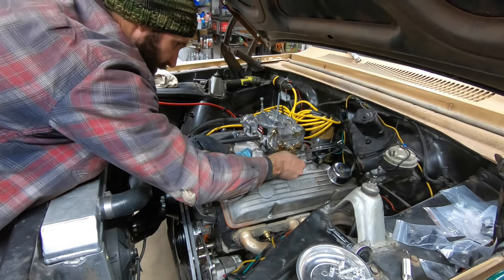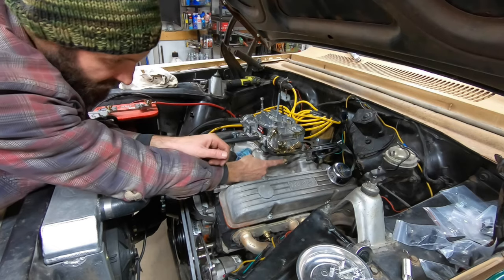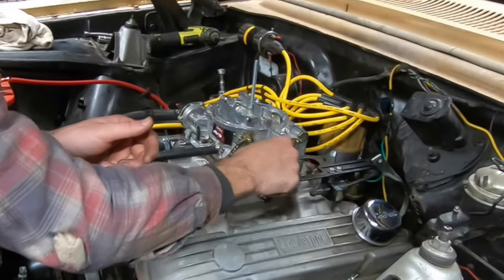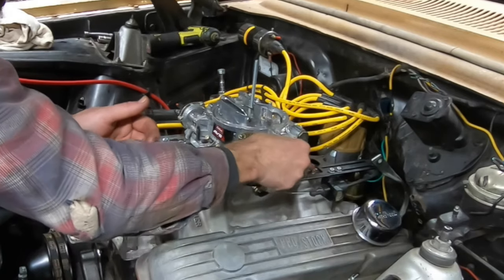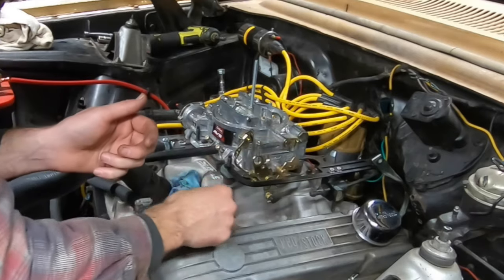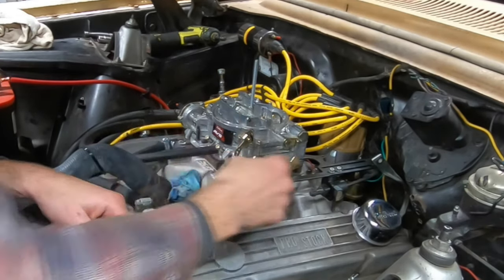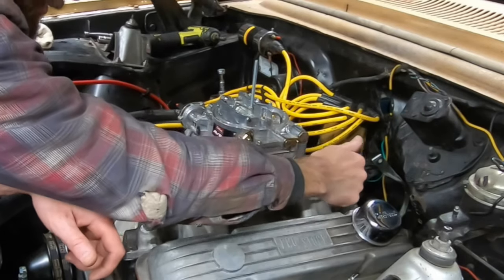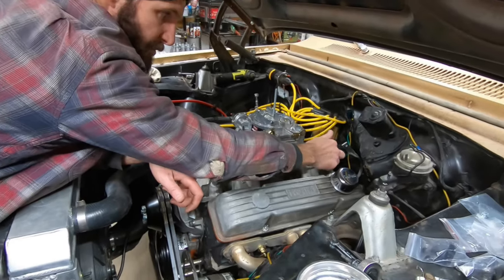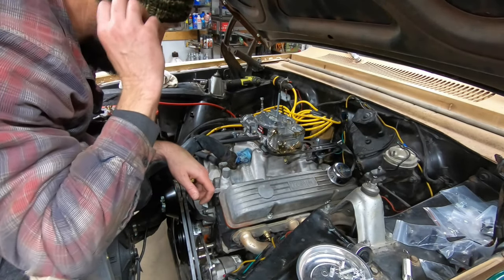TV cable's in place. And other than needing to shim the stud out so that it runs good and straight, yeah, it goes to full throttle without bottoming out the cable. I think we're probably good there. And when I cut this off, I'll leave a little bit more room for adjustment. Not a lot, probably another quarter inch behind there. And that should do it.